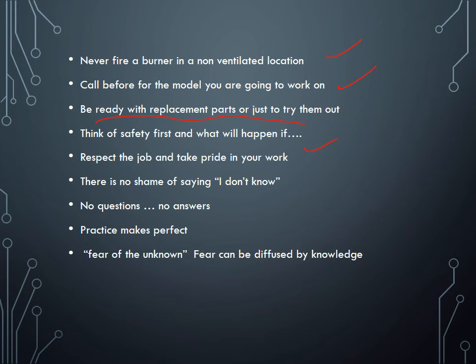Respect the job — put things the right way. Try to make it better than you got it. Make sure nothing is rattling and no screws are loose or missing. If you find loose or missing screws when you start the job, make sure to replace them before putting it back together. There's no shame in saying you don't know — if you encounter a model that's challenging, say you'll get back to them, look for information, and consult the installation manual. Don't take a chance taking things apart that you can't put back. Ask questions — from colleagues, employers, or the manufacturer's hotline, which has a lot of useful information.